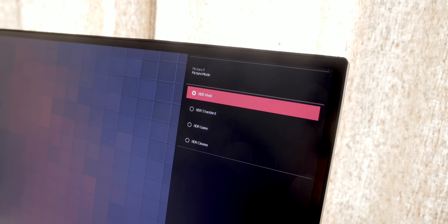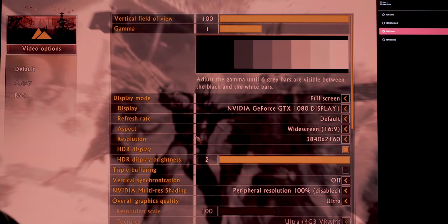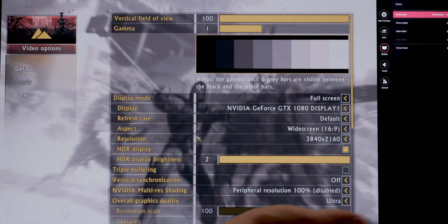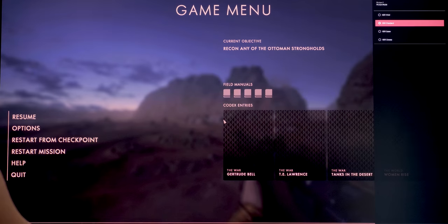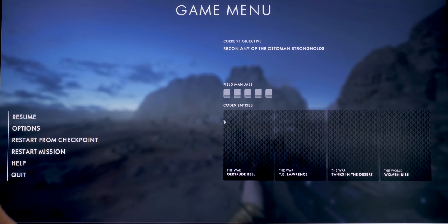There is one workaround I found to disable this pink blanket over HDR profiles on the desktop and in games — and that is to cycle between the different HDR profiles on the monitor itself. That is the only way I've been able to actually enjoy HDR; otherwise everything would just be pink and I'd have to go into the OSD and choose between HDR Cinema and Standard and cycle through until the colors go back to normal. This initial point of frustration is just a huge turn-off for HDR for all types of consumers. If you're a consumer and you buy the monitor, turn on HDR, and everything is pink for some reason, you would definitely return that monitor the next day.